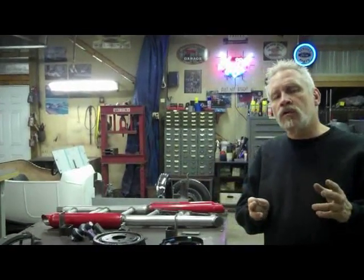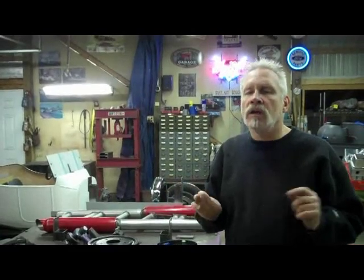And unless all of those parts were engineered to that frame, to that car, you start buying things and you get into, well, how do I set the pinion angle? Where do the engine brackets go, the frame-mounted ones? And now I've got to be a welder, and I've got to be a little bit of an engineer. I've got to be a really knowledgeable hot rod builder. It can be a little overwhelming initially.